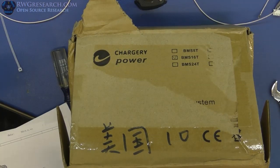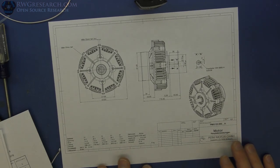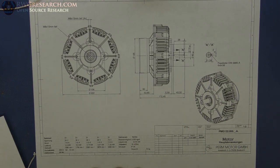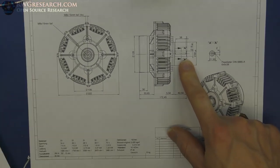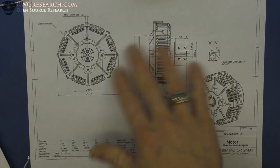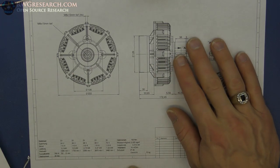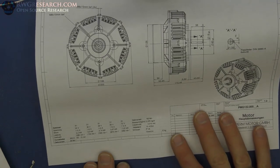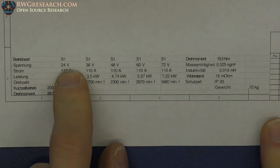Also note, this is a three-quarter inch sprocket on a 19-millimeter shaft, so there's a tiny bit of play. They relied on the actual flatness of everything to keep it square. The new pulley rides true and smooth. Now, moving to the data sheets: this motor can run anywhere between 24 and 72 volts, but my motor controller is maxed out at 60 volts. My battery voltage sits around 48, which actually runs at 52 volts. So we can't go over 60V with the controller.